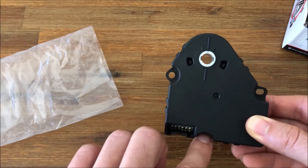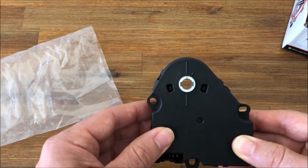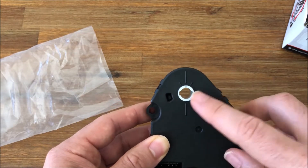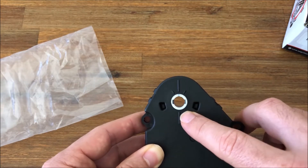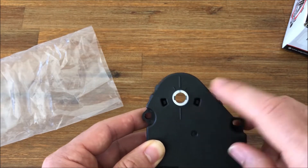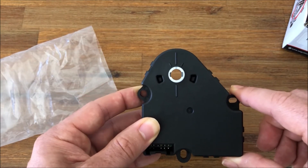You want to make sure all three screws are bolted in place and the electrical connector is plugged in before turning on the ignition. That will prevent the actuator from turning itself past the stopping point, which can cause damage — so you always want to make sure these actuators are bolted in place before turning the vehicle on.